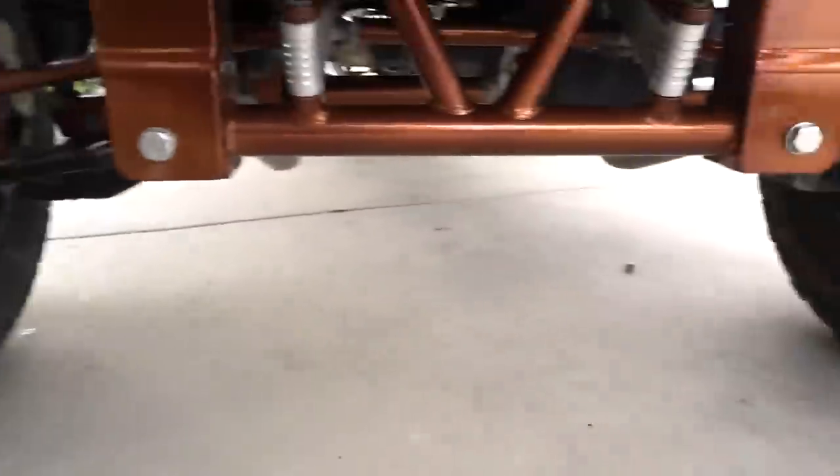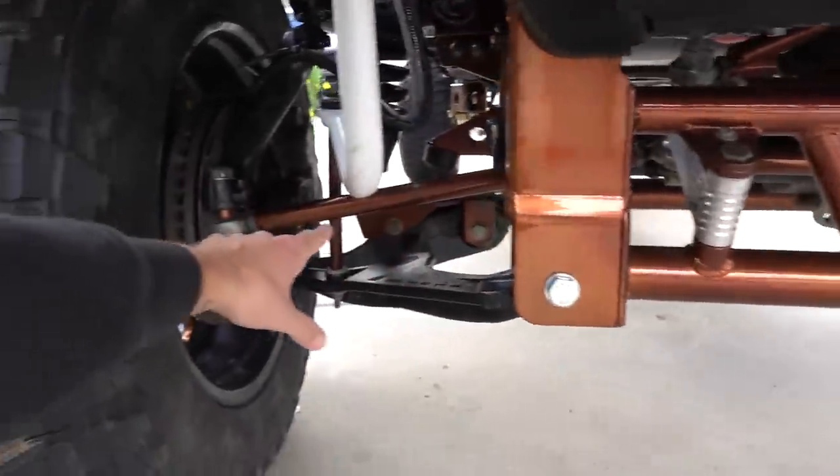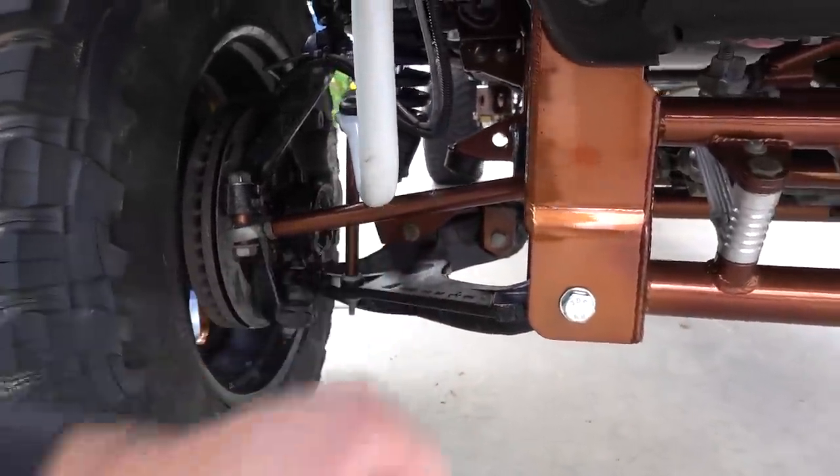The startup sounds a little weird. Good morning guys, welcome back to another video. We really haven't driven the old BBB here since we got it back from Superstition when we took it out in the desert and ended up breaking one of the CV axles — the passenger side one you're seeing right there. Good news is once we cut the CV axle out, the truck is still drivable — you don't need the front CV axles as long as you don't completely pull that side apart to where your wheel falls off.